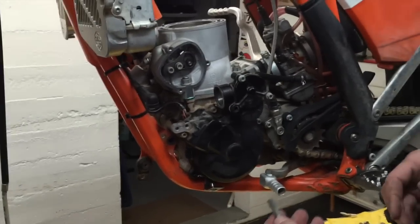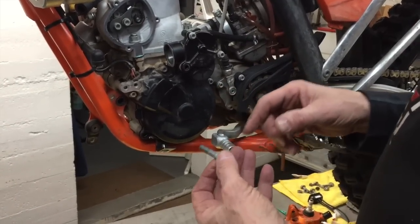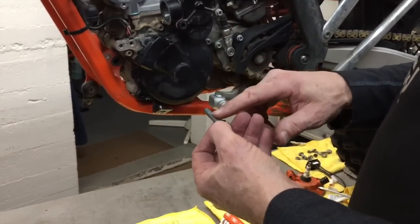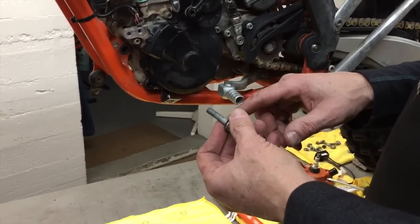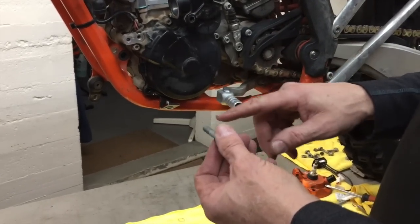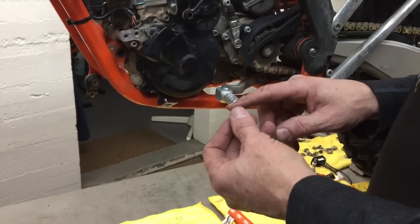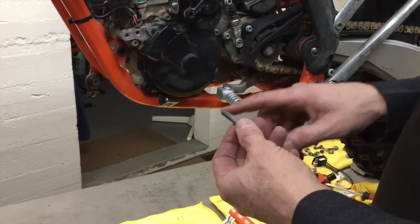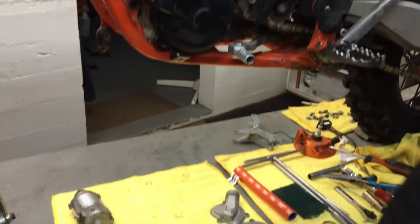And then you should replace these copper washers. And these bolts get really dry and kind of corroded from the coolant, and so in order for them to torque properly, you should put just a little bit of grease on them, just any kind of a light grease, like a lithium, a seal grease, a wheel bearing grease, anything, and just put just a hair of it on there. I've got some on there and you probably can't even see it.